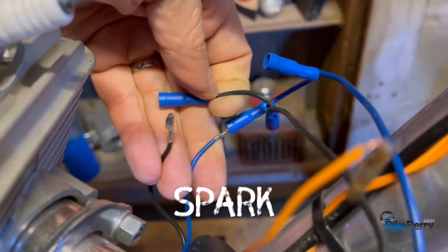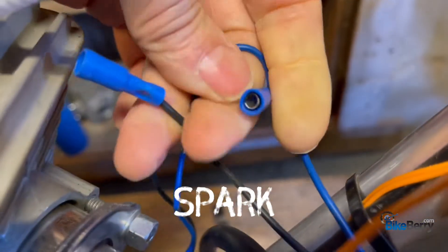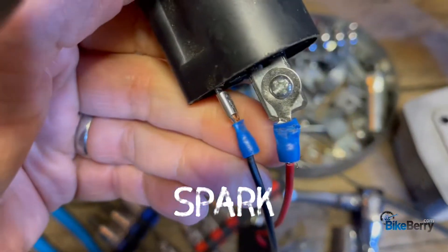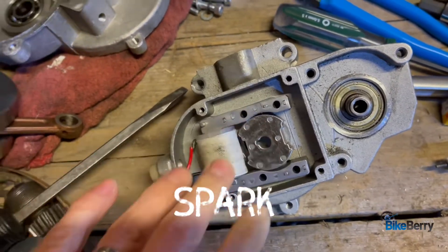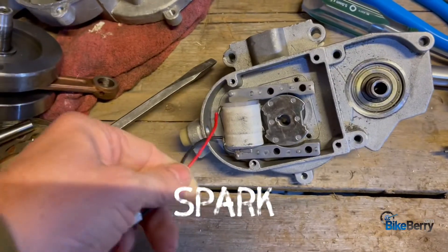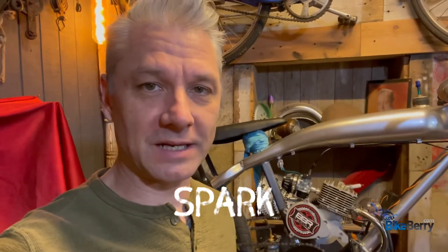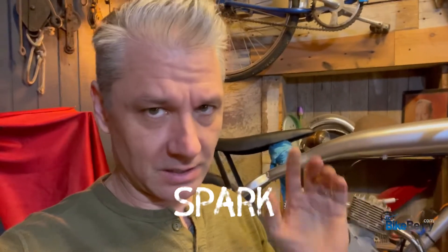The spark plug is your first place to check. A lot of times these connectors can come loose or not be pushed in all the way — the barrels can open up inside. Check those and make sure the connections haven't slipped loose. If you have a stage one or stage two CDI, make sure those connections are tight also. Always start with the surface stuff: spark plug, CDI. The magneto is the last place you want to look because nine times out of ten it's going to be one of those connectors. It's almost always those connectors.